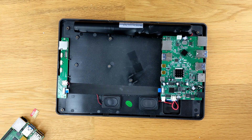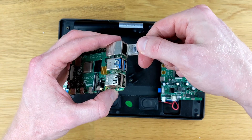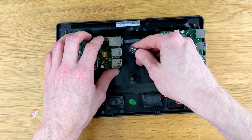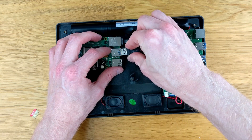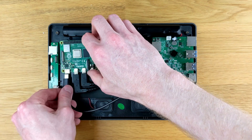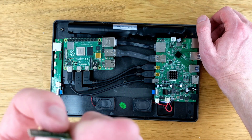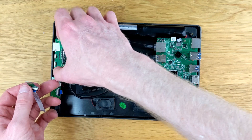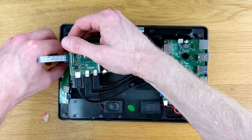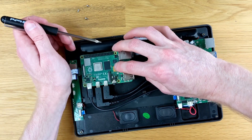To test out the instruction manual, I decided to follow it step by step, just to see how the experience is for the end user. It's very simple and straightforward. The first step is to connect the Ethernet cable. Step 2 is to connect the short USB cable from the Raspberry Pi to the Raspad. Step 3 is to connect both micro HDMI cables. Step 4 is to connect the double-ended USB-C cable. Step 5 is to connect the micro SD card slot adapter to the Raspberry Pi and also to the Raspad.